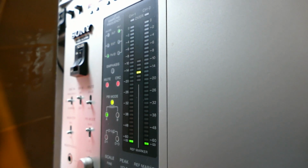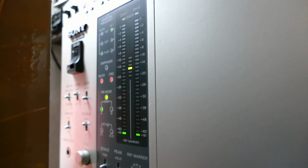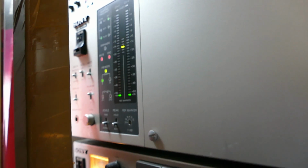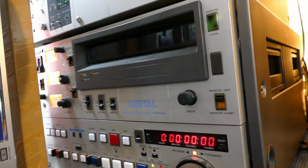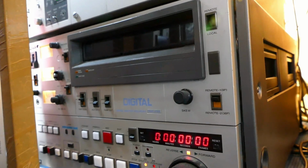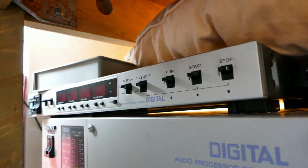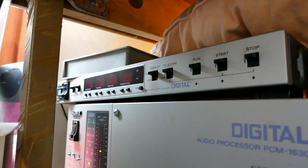It gives you a very important feature which you might just about be able to see on the display, which is called RAR, which I believe is called read and read. So it can read the tape on two passes of the heads going past the tape on the drum, and try to correct for errors, which is almost an admission by Sony that the format is somewhat fragile, and errors were a problem. And actually I've got a machine at the top here which I don't use, but it's available for recording, which actually counts and logs errors, and you can print it out on a printer, which is again just kind of saying, you know, errors are a fact of life on this format.